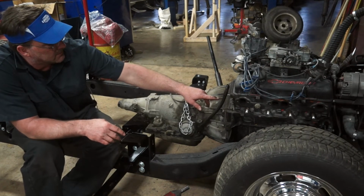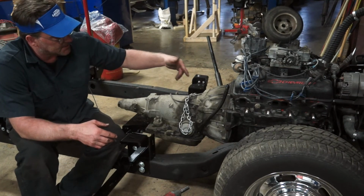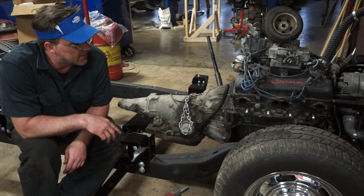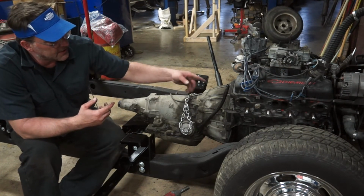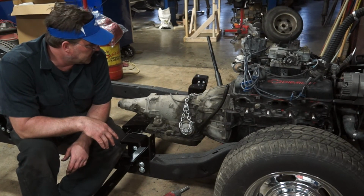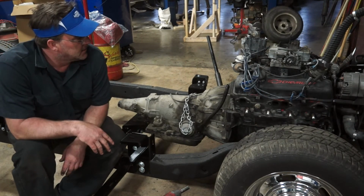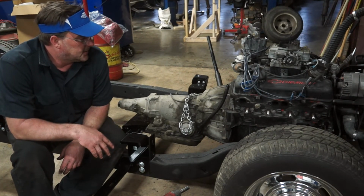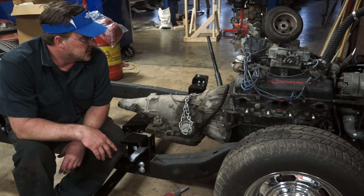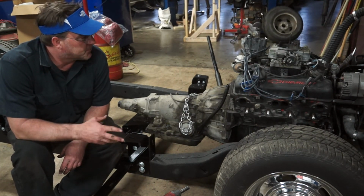As I said, this motor mount, the engine actually needs to come back more because I'm not centered over here. So that'll pivot back. I just need to notch it a little bit. I need to get a fuel pump block off plate, and I need to remove the fuel rod from inside the engine, so when I have the mount off to modify it and clearance it, I will make that a reality. Then we will run our fuel lines, our brake lines to the back, everything under chassis, and then it's time to see if I can get the coil springs in this thing. That would be nice to actually have it sitting sprung. And it's time to put the body back down on this thing. Moving pretty good. Got a lot done.